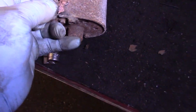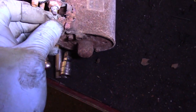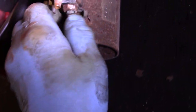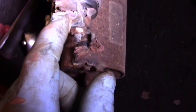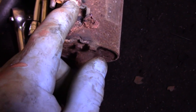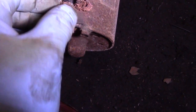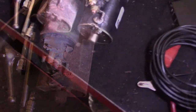Remember we talked about that wire that frays all the time? Look at this — it's broken all the way through. That's the wire that's actually broken. Power comes through the solenoid, the start side energizes it to bring power down to the starter motor through that wire, and that's what happened to it. Let me make a phone call and get the starter, and we'll continue.